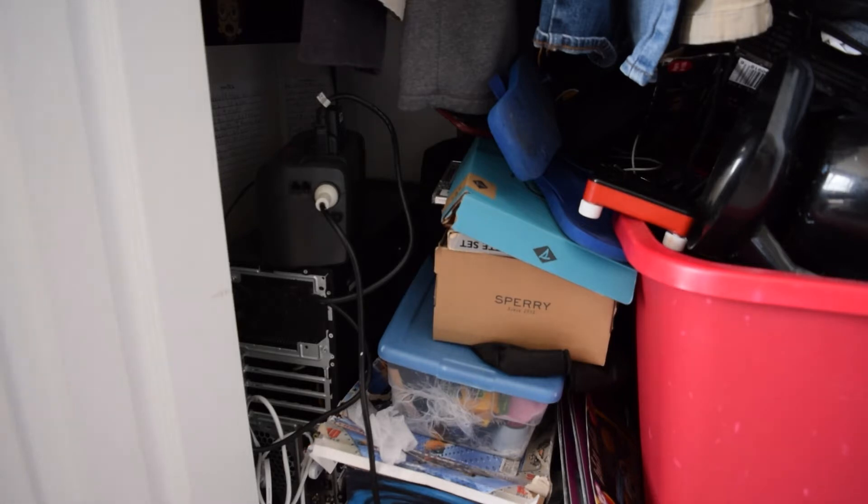The first thing I need to do is get our Torx driver — because of HP — and take out these screws. Actually, the first thing I should probably do is unplug the cables over here. The motherboard is a Gigabyte GA-78LMT USB 3, a very standard sort of AM3 motherboard. It's not the HP board — I replaced it with this board because I got it for free, and more importantly the HP board doesn't have Gigabit Ethernet, and this does. We've got our two WD Green drives right here — they are pretty warm.